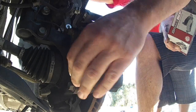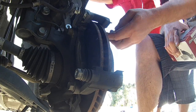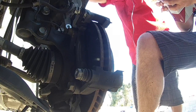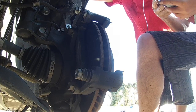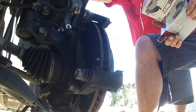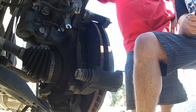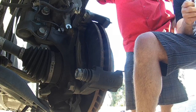These are just the brake pad slides. Do you replace them? Only if the kit comes with new ones. Typically they don't — the factory ones don't. Well, it depends on what factory you work for. None of the hardware comes with factory pads. You'll get more hardware from an aftermarket brake pad.